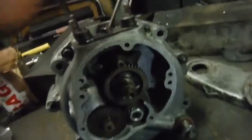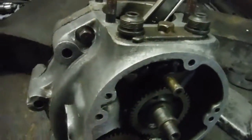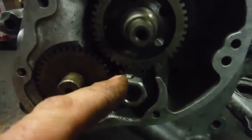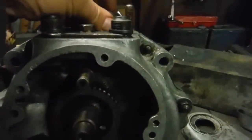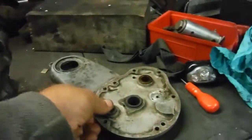So now I can concentrate — I've got the timing sorted out, the valve timing. And I made a nut up for the very coarse thread that was on the end of this crank but had no nut for it. I've done all that, made a tab washer up, it's all tightened up, the cam timing's done. So my next job is I'm going to fit the cylinder barrel and the piston next.